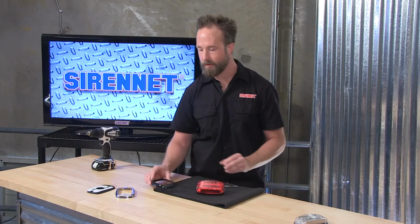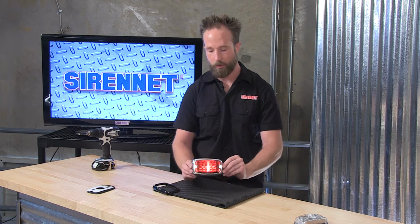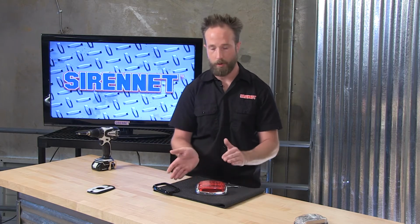What's nice with the flanges is, unlike some of the other Whelen larger lightheads, 400 series, 600 series, the flange is something that needs to be added around the light head on the installation. With the M series, the flange just is a simple overlay versus some additional retainer screws where the square version of the light heads, again 400, 600, 7s, the flange installs a bit differently, so simply adding one after the fact, a little more difficult on the older light heads, but very simple to do on the M family. So if you don't happen to order them when you're doing the installation, you can get them later on down the road, add them on, very easy to do.